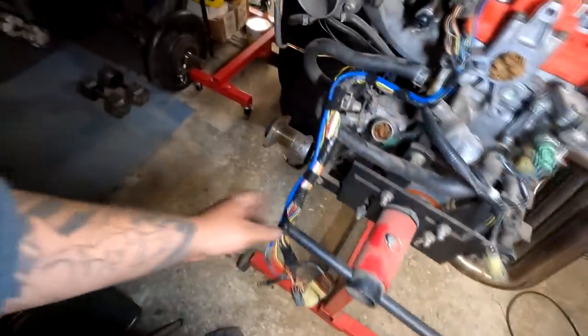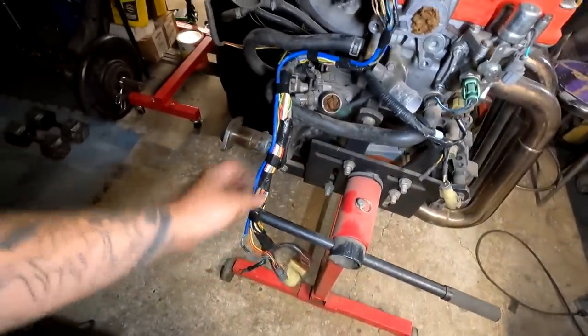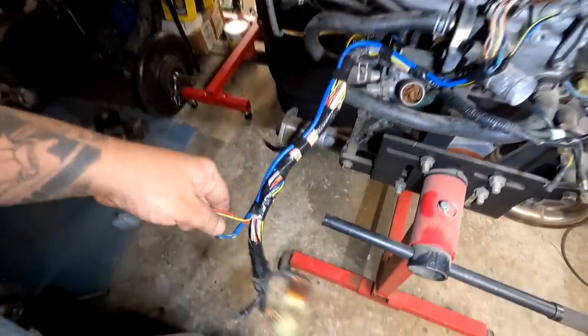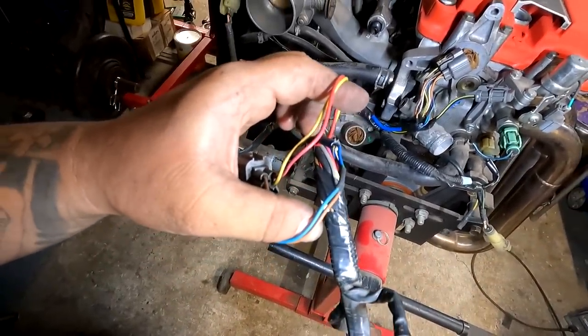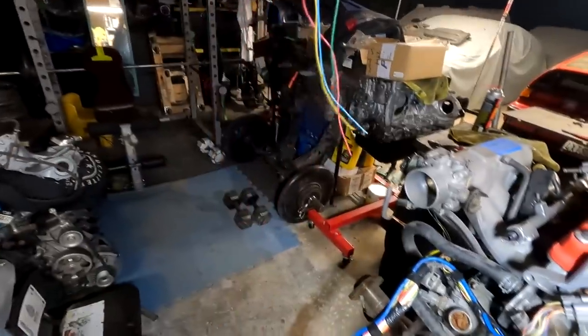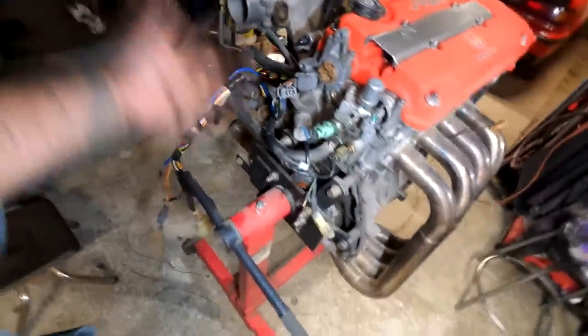We have ECT engine coolant temp and the reverse light switch — not entirely sure what transmission he's using, but OBD1 and OBD2 have a different plug than OBD0. The OBD0 O2 sensor is going to stay, although this engine needs the four-wire style, which is integrated into the ECU jumper. On this side we have the starter cable. There are four extra wires that need to go into the ECU plugs — the two crank wires, blue-green and blue-yellow, and injectors for two and four. I have the sub harness that plugs into that plug and goes through the firewall to the ECU.